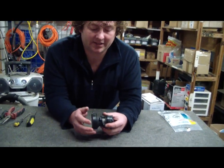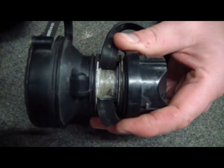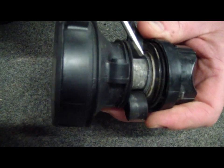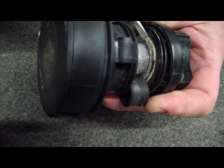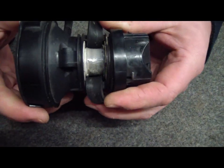Let's first have a quick look at the clutch itself. I'm going to point out that this particular one isn't worth doing — it's just for show. You'll notice here, see how the little roller is melted? I wouldn't put a belt in there; it's just going to run offline and likely break anyway. But for the sake of this video, we'll use it.